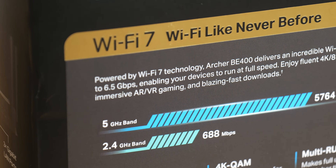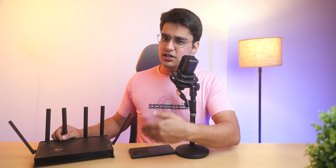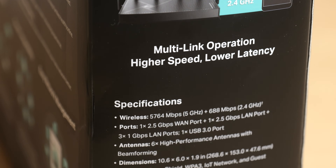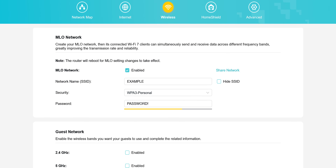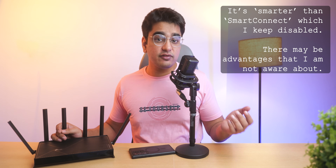These are the first routers to be released with Wi-Fi 7 in India, but some of the biggest and most important features of Wi-Fi 7 don't make a big difference on this router, because it is only a dual band router without a 6 GHz band. We do have a multi-link operation (MLO) feature on this and it does work as it should, but combining 2.4 and 5 GHz bands doesn't really improve speed. If you combine 5 and 6 GHz bands you'd get much higher speeds, so the only real advantage of MLO here is that you don't have to switch between 2.4 and 5 GHz.